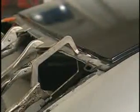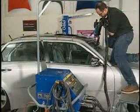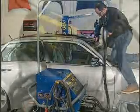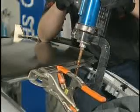Allow the adhesive to cure for one and a half to two hours at 21 degrees Celsius before removing clamps, unless welding will take place within this time frame. Clamps may be removed immediately after the panel is welded. Expect the adhesive to be a little tacky on the surface, as this is a normal property of the adhesive. Now we are ready to weld bond. Be sure to review all pertinent information about the use of the squeeze type resistance spot welder before you begin. Consult the welder manufacturer for the approximate recommended settings for weld bonding. You may begin welding immediately, any time during the adhesive cure process and or when the adhesive is fully cured.